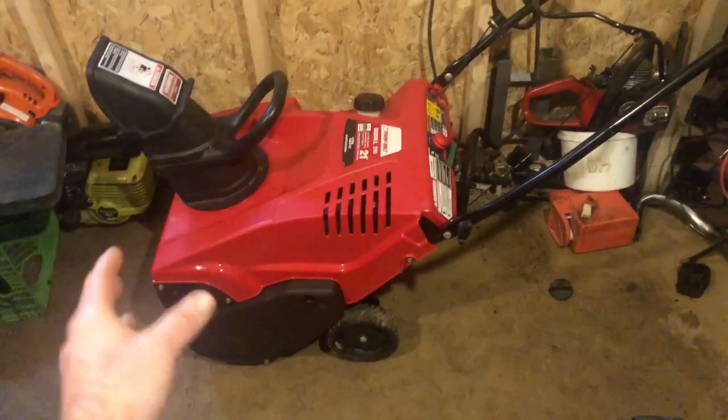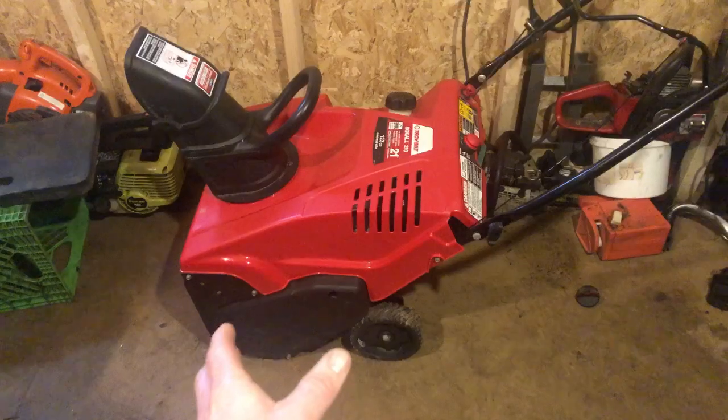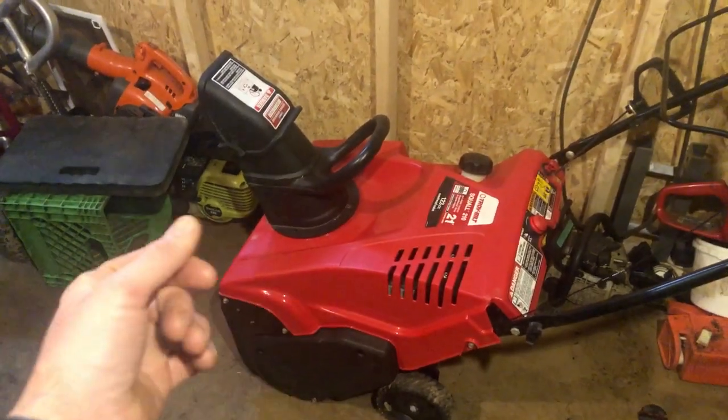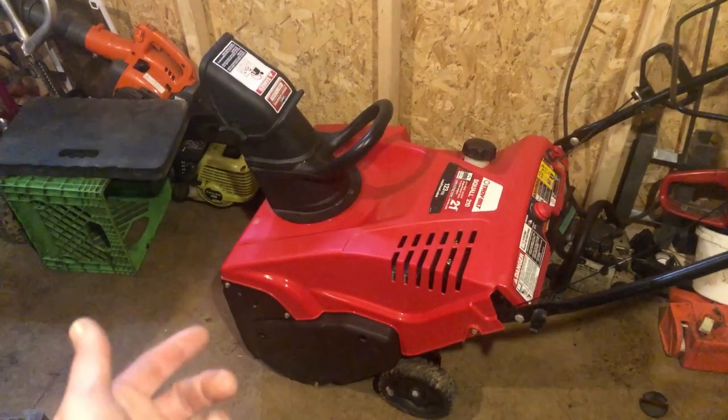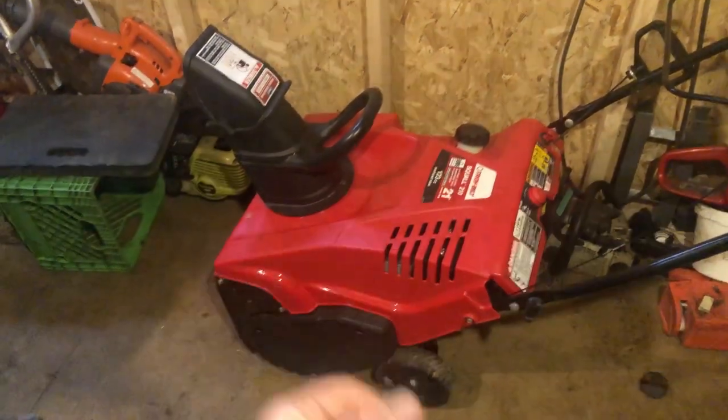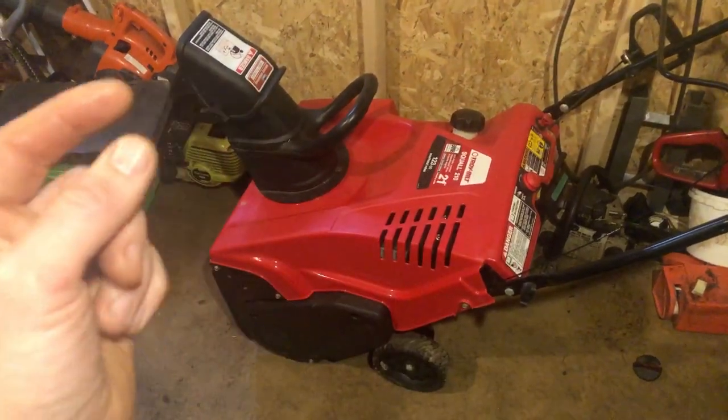I thought it'd be a good time to make a video on what to do if you have an erratic idle on one of these. And the number one symptom would be the low speed circuits clogged up. And with the carb cleaning, it should solve that 9 times out of 10, but not the case for this one.